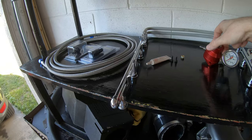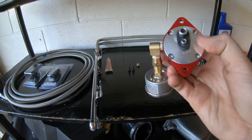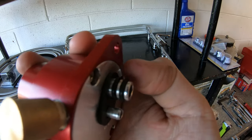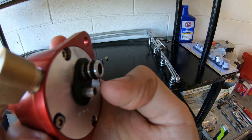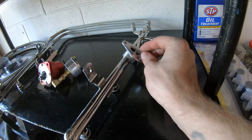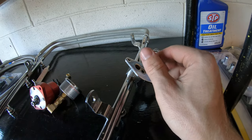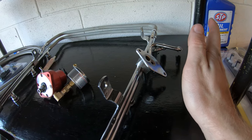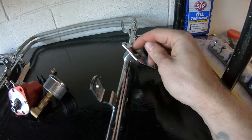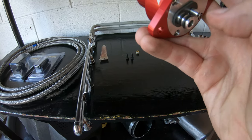We'll start with the regulator — we got an Aeromotive regulator. You're also going to have to order this gasket right here; it did not come with it. The bottom oval gasket — it came with the O-rings for the stem but nothing to seal this up. So when you mount it to the rail, it could leak out of there. The OEM regulator has an O-ring that sits in a counter bore, but they don't sell it separate, so you'd have to buy a whole other OEM regulator. I found this gasket and it should work very well — I'll put the link to it in the description.